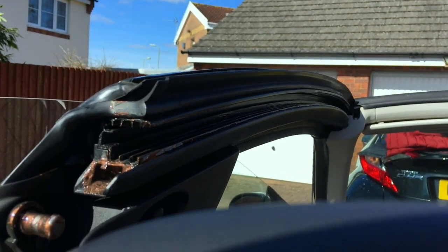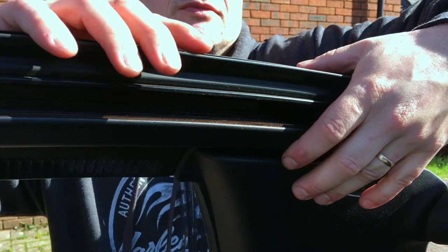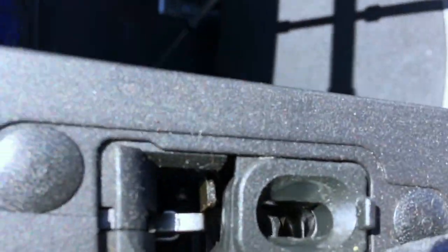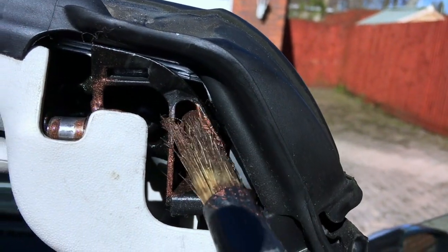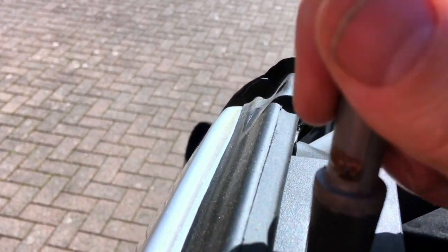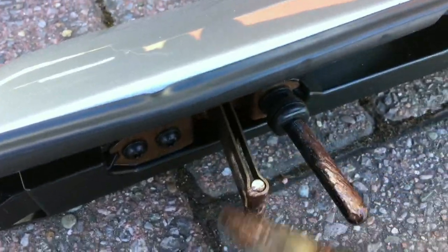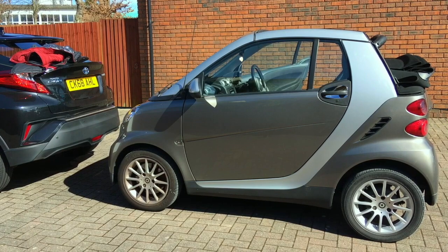This is the back rail — pay attention to that as well, make sure that's covered. The whole top of this pillar has a rail going across — that whole top rail actually comes out so you can do a proper open-top feel. Give that a little bit of love as well where the locating pins at the back go in. There's the hole and the grease on the hole — that's what you're looking for. There's also a guide hole there for the actual rail, so we want that to have a bit of grease on. And there's the location for the pin on the top rail — give the receiving pin and that spring a little bit of grease too. Into the front of the actual top rail locating bar, then put it all back in.